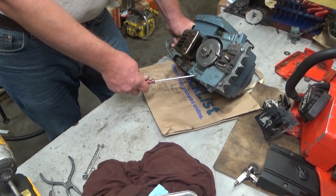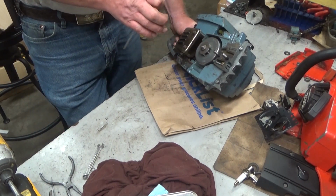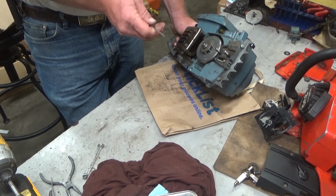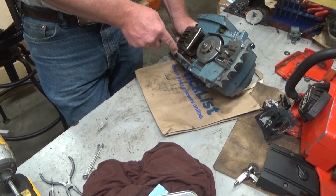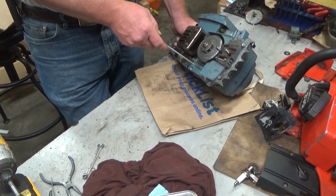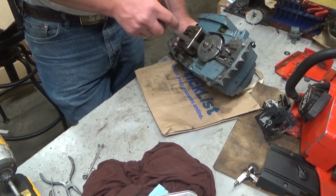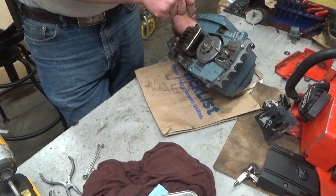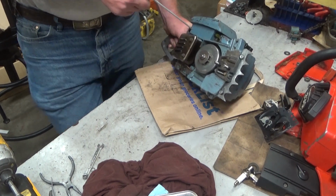It's probably down here. So I get this case off, and the way it came off, I could tell that it had been off. I'm 90% certain it has been off before at some point, and I know for a fact that a piece of gasket was torn in there. Now, whether the screw came loose, and then it blew the gasket, how it happened, I don't know, but the gasket was bad. So replace that, replace the crank seal on this side because I was there. That's just a no-brainer. And it ran a lot better.